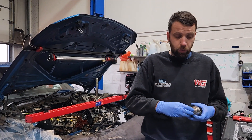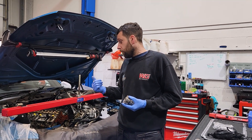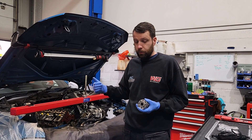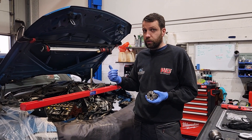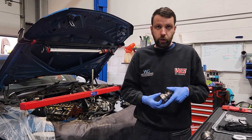If you go to stage two and want full torque, we definitely recommend one of these upgrades to avoid coming off the road while waiting for a booking or getting stuck in limp mode. Worst case, if it completely slips, the valves will touch the pistons, then you've got to take the cylinder head off — it's a major overhaul with all new valves and maybe even valve guides. So it's definitely worth thinking about before getting into tuning.